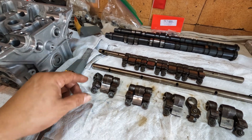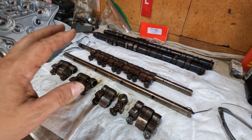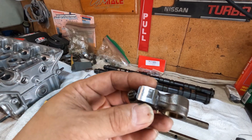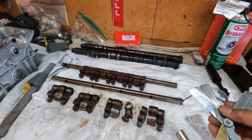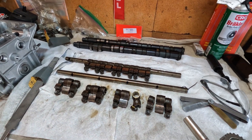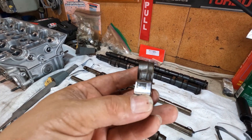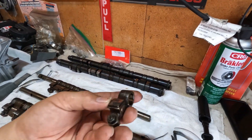I have done this repair in the past and never had any problem with it. The reason I'm sharing this is: if you ever find wear on your rocker arms you really have to do something about it — either get a replacement or just repair it like I'm going to show you. On the H22 the intake valve lash is six to seven thousandths and exhaust is seven to eight thousandths. If you have this wear you are getting incorrect valve lash settings — you're going to end up with less clearance because those grooves mean the cam lobe is already digging into the pad.